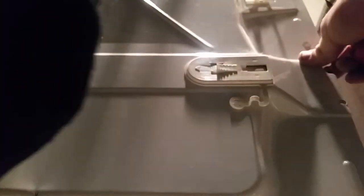Now again, this one was a Maytag, but it's very similar for other brands of front loaders. Most of them have these collection bags and the little drain port access. There are even a few top loaders — there's a GE that has that same collection bag and pump assembly setup where you can get in there, take out the plug, and pull coins out.